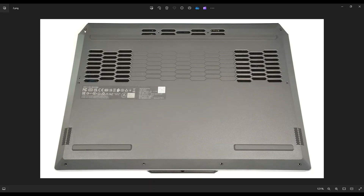After you get those screws out, you're going to take your small flat plastic pry tool. I say plastic because metal pry tools will tend to scratch your case a lot more than plastic ones will. I would recommend starting in the back corners here. You're going to pop it open, go around this seam, and pop the bottom case up from the computer. Then go down each side and finish up on this edge — this edge is the hardest to get off. So go from the back to the front on this computer.